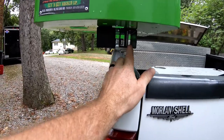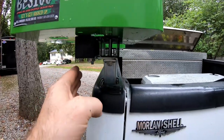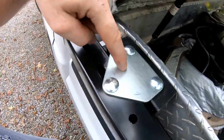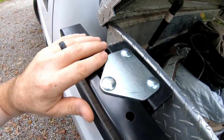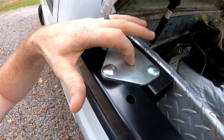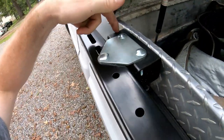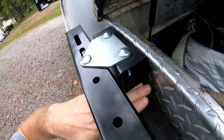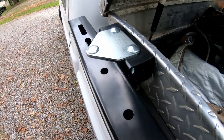Normally what you would do is mount the rail right on top of the brackets, just like this piece of square tube. But since I needed to offset it to utilize my toolbox, I took these brackets — you probably recognize these, they're actually off of the trimmer rack mounting system; you get a bunch of them with every trimmer rack. I took one on top and two on the bottom to create the offset. I also used a piece of the same size square tube to give it solidity, because if I just put the pieces on the bottom it wouldn't have been very solid — it would want to rock back and forth. But this way, if you try to rock it, you rock the whole truck.